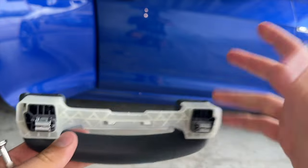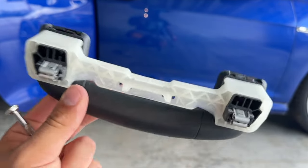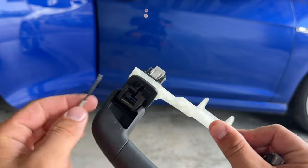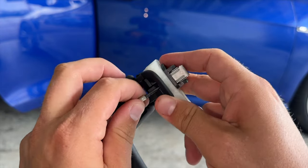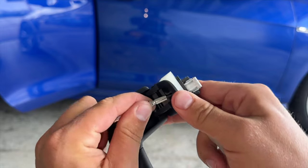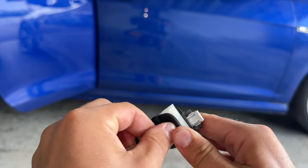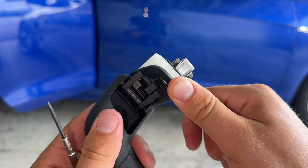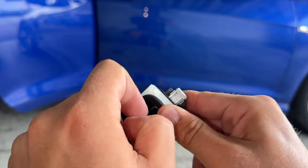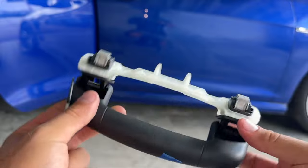Update for anybody trying to remove the handles to remove the headliner: what took me 30 minutes for the first one, I did the last two in under five minutes. Instead of turning the screwdriver, you want to put it inside, get behind the clip, push as far in as you can, and pull up rather than turning 90 degrees. That pulls the clip down and it pops right out — so much easier. You just have to put tension on it, insert the screwdriver, use a light for the first one, pull up the opposite way to unlock the clip, and you're good to go.